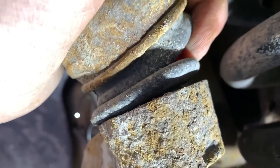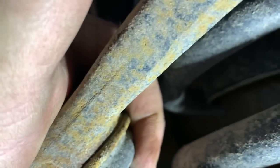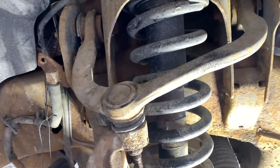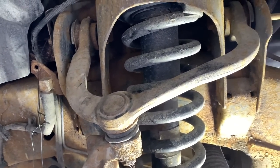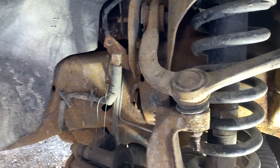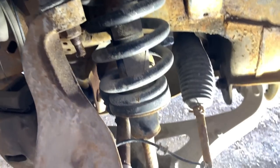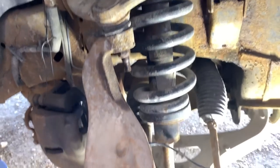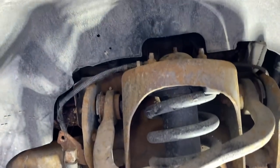Getting ready to start doing this and I noticed the upper ball joint is ripped as well, so I gotta do the upper control arms too. Which sucks. Rock Auto — they're half the price but they want to gouge you: eighty dollars shipping and not here until Wednesday. So I'm just gonna get them locally in town. But before I run down and get them, I want to continue busting things apart because now I gotta tear apart the whole front end again, bust the strut out. This is a nightmare.